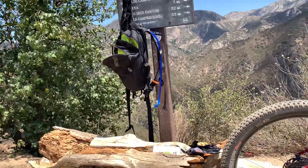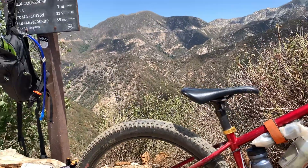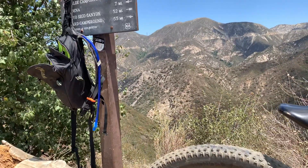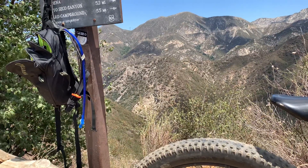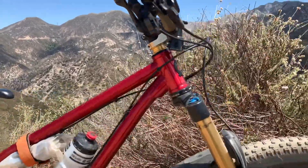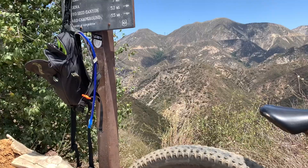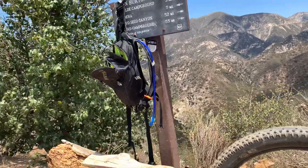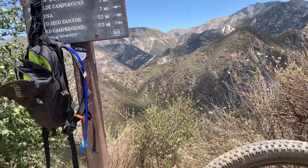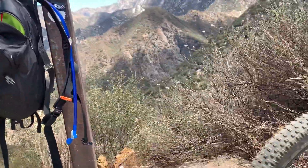Thanks for watching, guys. If you have any questions about 275 plus tires, I'll be happy to talk to you about this. Since this tire has a thinner wall, I'd go a little higher pressure than with my thicker casing Terravel tires. This one is 14 to 14.5 PSI in the front and 16.5 PSI in the back. On the Terravel thick-casing tires I was running literally around 10 PSI, and it still handled perfectly. Anyway, I'll talk to you guys later — thanks for watching my channel.